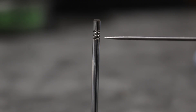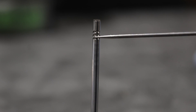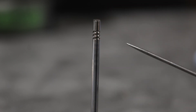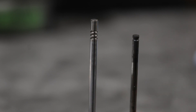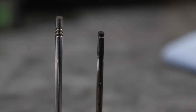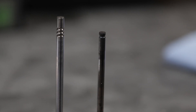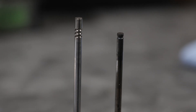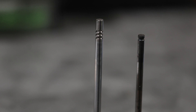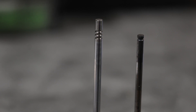The reason why they don't come apart? Triple groove. Triple groove is a one-two-three triple groove valve lock, and this is what helps the retainer not come off — that's the biggest attribute to a Ford not coming apart. Comparatively speaking, a single groove is why you see a lot of Hondas coming apart. That single groove will drop a valve very quickly, and that is why you never hear about BMWs or Coyotes falling apart — it will beat itself to death before it comes apart.